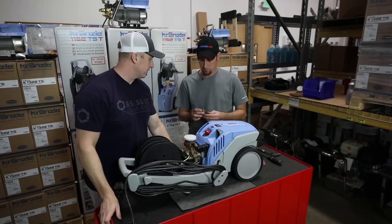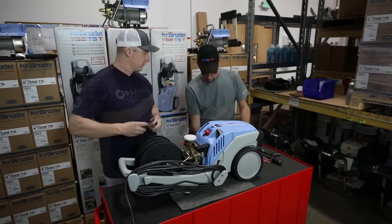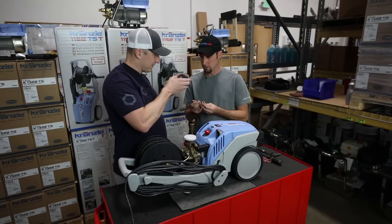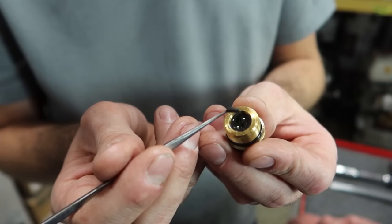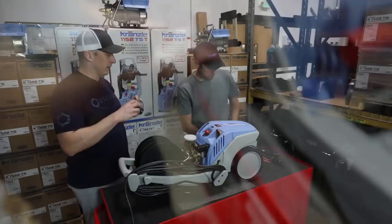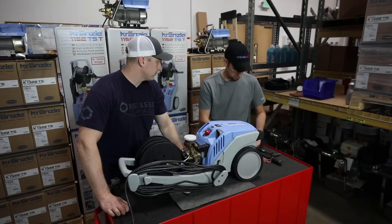The drain plug has a magnet, so you'll find that your breakdown wear has dropped to the bottom and adheres to the inside of the base of the plug. The focus transmission components are stainless steel, but even stainless steel has some magnetism, so gravity drops it to the bottom and it all adheres to the plug. You want to clean that out — sometimes I use a little bit of parts cleaner or choke cleaner.